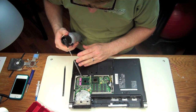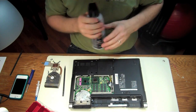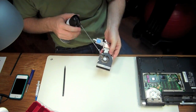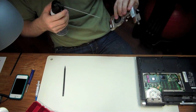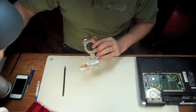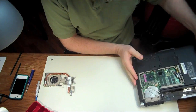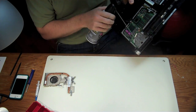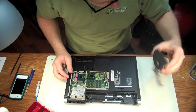We're going to take a little bit of compressed air and blow that off, dry that off — same with this. Make sure it's clean and it's dry. And then we're going to take the fan assembly and blow this out. We've got that fairly clean — looks good to me. There was more dust in there than I thought there was. While we're here, we might as well just blow out the laptop body too and get all that dust out.